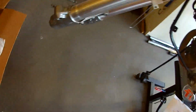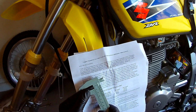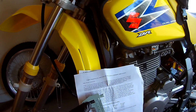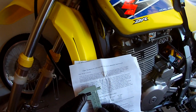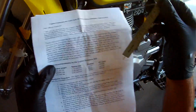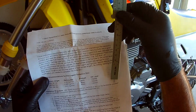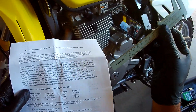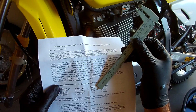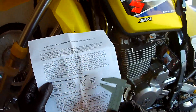But anyway, I have the 0.63 spring rate, and see here it gives you the 8 millimeters of preload, and that is what I got when I measured with my handy dandy plastic. Like I said, I have a digital one, but God knows where it's at. Okay, yeah. So there's 8 millimeters. Good. So anyway, that little barb hanging off the end of this, there's your 8 millimeters. And so I had that much preload with the spacer.